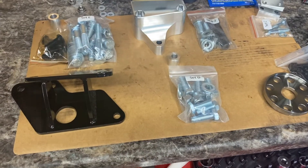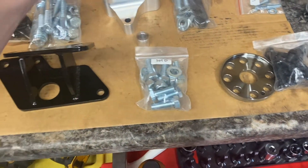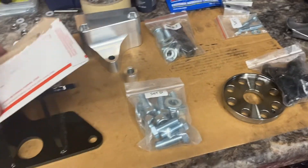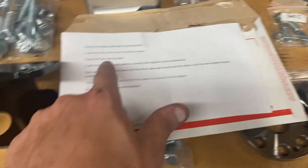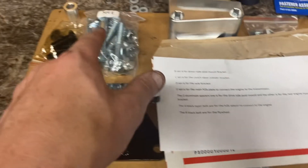The F-22 is going to be an F2B, and a year ago I actually bought the F2B kit. I opened it but didn't really look at it, so I'll unbox it today and show you guys. It comes with instructions and an adapter plate — inside the instructions it tells you what you need from each baggie, and each one is marked, so like set C is for the clutch slave cylinder bracket, set E, and so on. While waiting on parts for the orange car, I ordered clutch pressure plate bolts and a clutch kit, so over the weekend I'll probably work on getting the F-Series mocked up and ready to go in the car.